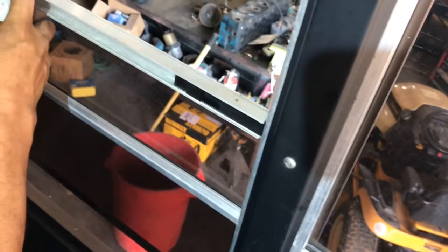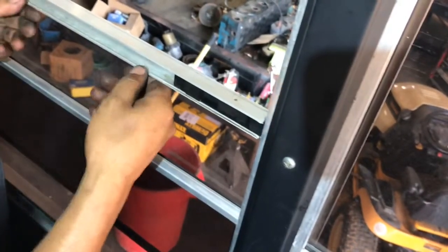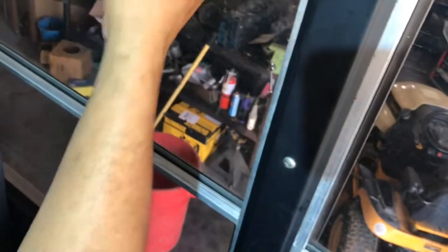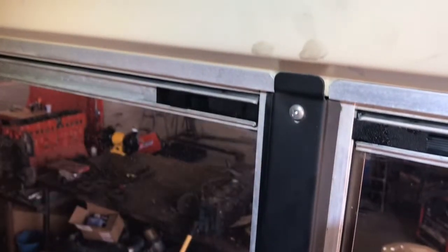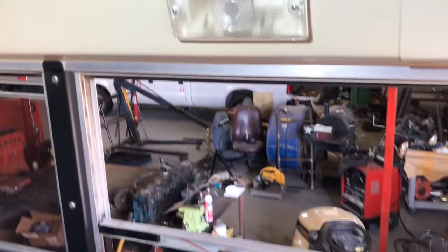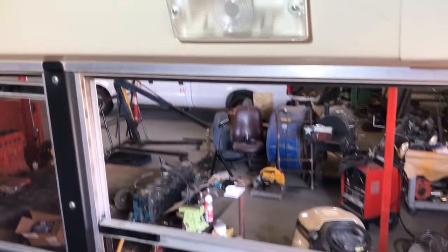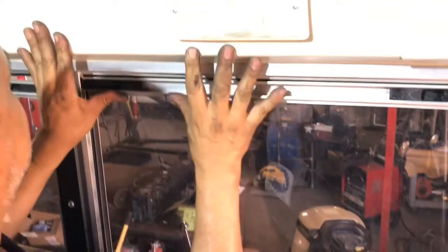Lubricate the latches, lock — windows no longer sag and the locks are actually in. That's how we do the window locks on these buses. I'm going to go ahead and lubricate both of them and just make sure there's enough lubrication so the sliders don't get stuck. The window was sagging, and now — voila — that one's done.